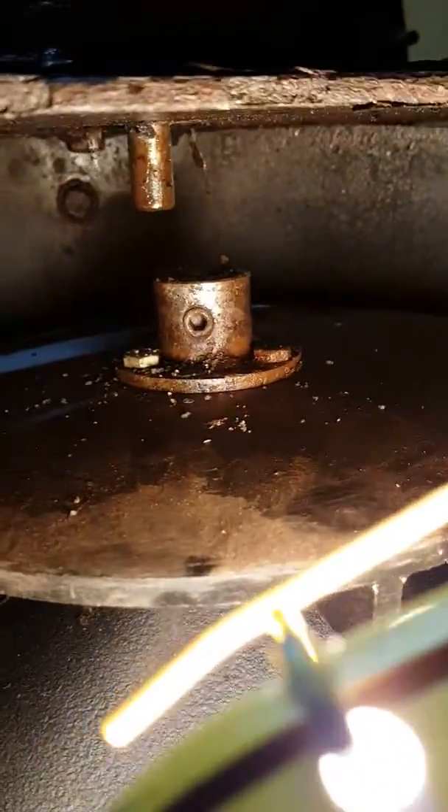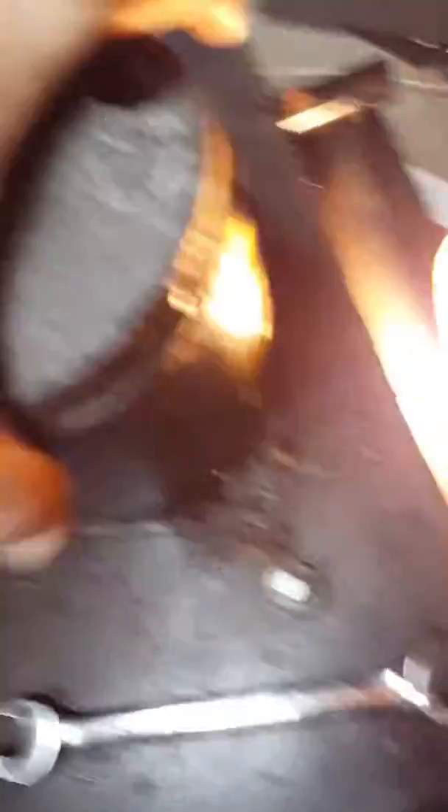Once the set screw was out, I had to come in with a crowbar. If you're replacing this motor, don't be scared to put a little bit of work into it. There's a little bit of play — you can put that crowbar right up under there and work it around all the way around, give it a couple good cranks, and once you've got that all pushed out the motor comes right out.